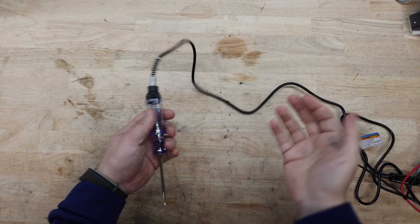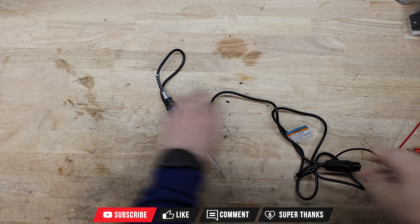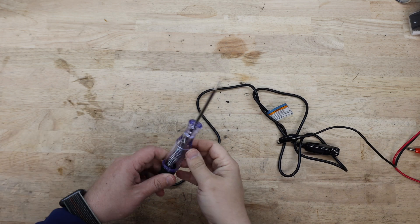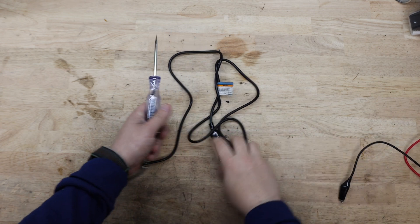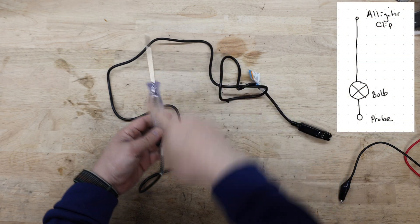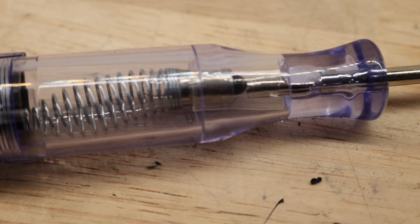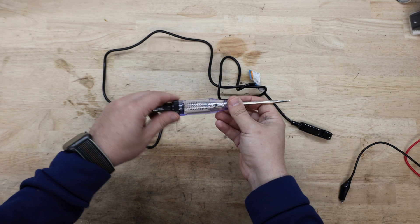Here's your standard test light. They're unbelievably simple. You can actually buy ones now that do have a voltage indicator on them, but this one does not. I'll leave a link in the description for a setup like this that you can pick up. Essentially, all you have is one circuit — everything in here is in series from here to here, and there's a bulb on the inside. The bulb is a 6 to 12 volt bulb, so this one can actually do 6 volt systems and 12 volt systems.